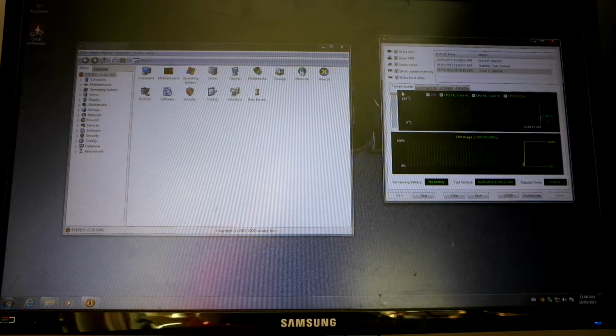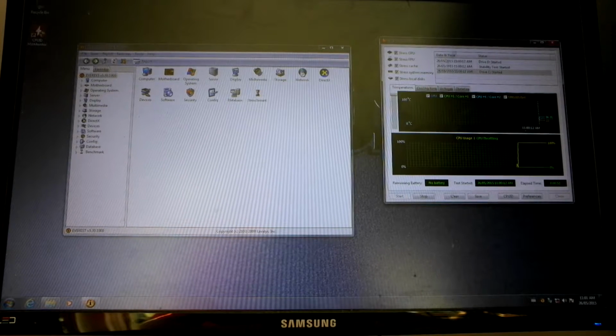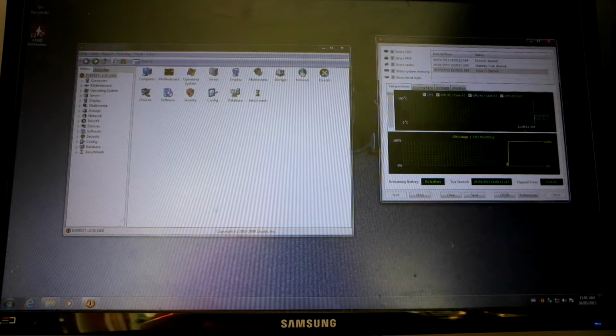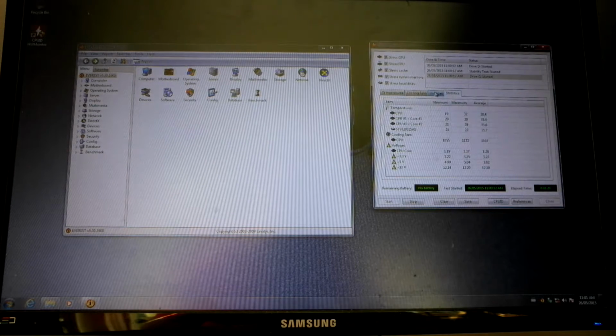I think they changed names a while ago, because I'm using an older tool now, because I've had this tool for a long time. They changed the name to AIDA64, which is pretty much the same tool. They just used to call it Everest. These days it's got a different name, and it basically does the same thing. It does stress GPU and everything else. It stresses a lot more these days. There's a lot more extensive tests you can do with the stability test on it, basically to make sure the system's running correctly.